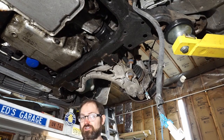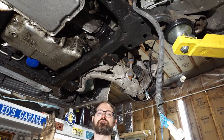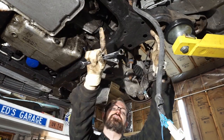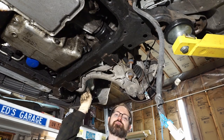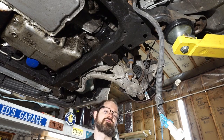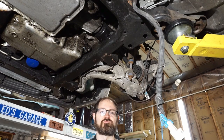We're basically ready to remove the entire powertrain from the vehicle at this point. What holds this cradle in is six bolts — one, two, three on one side and the same on the other side, four, five, six. We also have two motor mounts, one on either side — technically one is a transmission mount and the other is a motor mount. And then there are three nuts at the top of each strut holding the struts in. We're going to do a couple more things to get it ready so that we can pick the body up off of it.